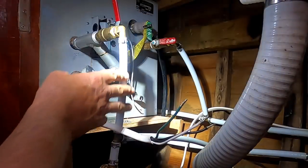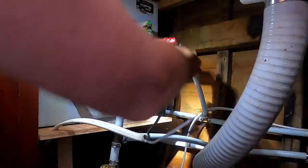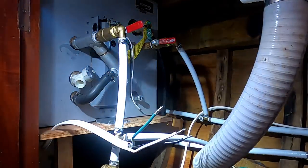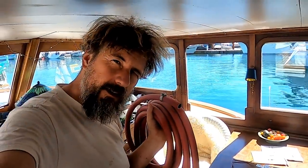The whole logic to putting this thing here was that the closer you put the hot water tank to the kitchen sink — the most common use for hot water — the less water you waste, because every time you turn on the hot water it's instantly hot. On a boat, that's important. You don't want to be waiting for water to get hot while it's going down the drain. It's in — PEX is all reconnected. I've just turned the water on for a pressure test. Let's start making electric hot water, and tomorrow we'll connect up the engine hot water. This was miserable, but it's done.